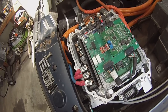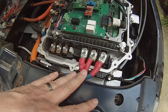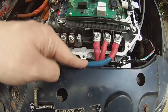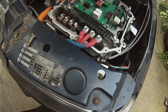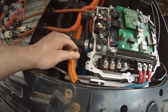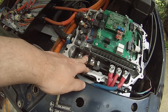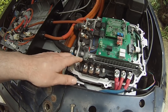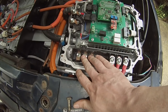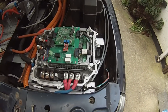This is a simple breakout board I made for this inverter some time ago. You can see the phase wires for MG2, which is connected to the rear driving motor, but they're too tight against the panel so we'll need to section out a bit of that. MG1 here will be connecting to the front drive motor with three phase cables. This is a dual inverter, so it can run both motors.